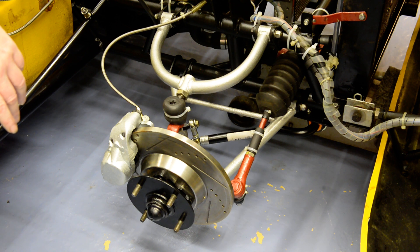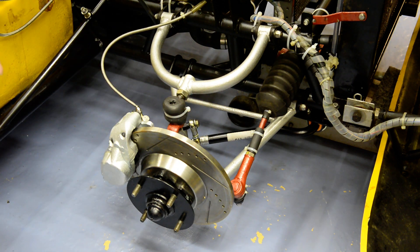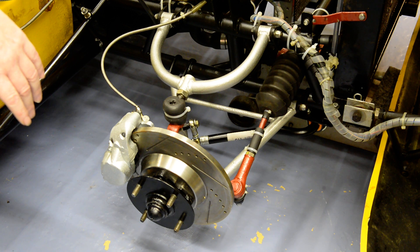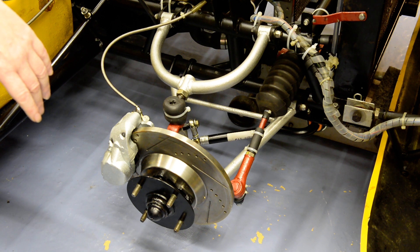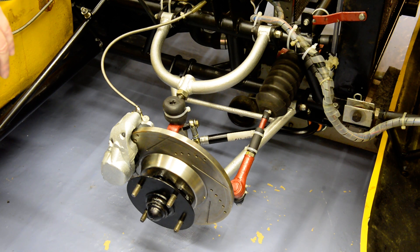In order to fit those drop links, I've used 11 or 12 washers with longer bolts — the bolts are grade 8 or grade 10. The car really could be used without an anti-roll bar; it would be interesting for any owner to try it without and then with, to see how much difference it makes. There is an argument about whether you should control the roll of the car with springs or the anti-roll bar. My view is you control it with the anti-roll bar and use the springs to set the suspension hardness and softness.